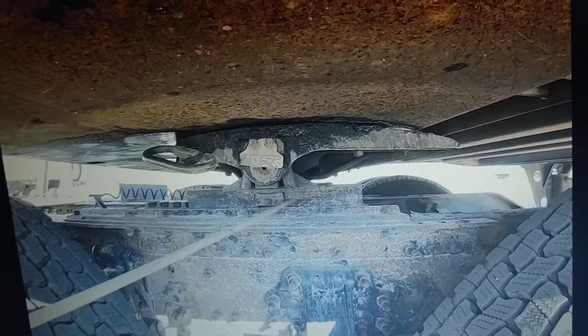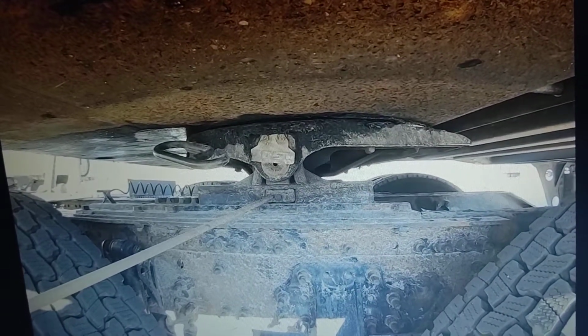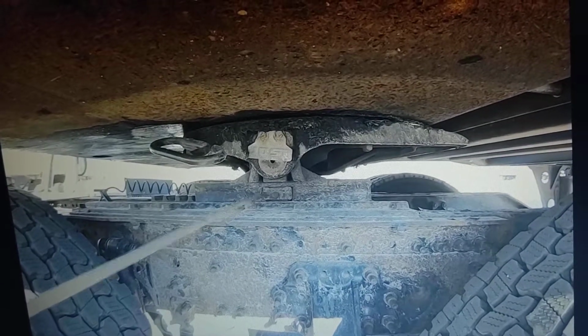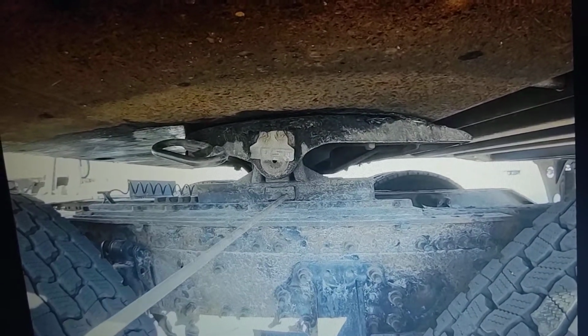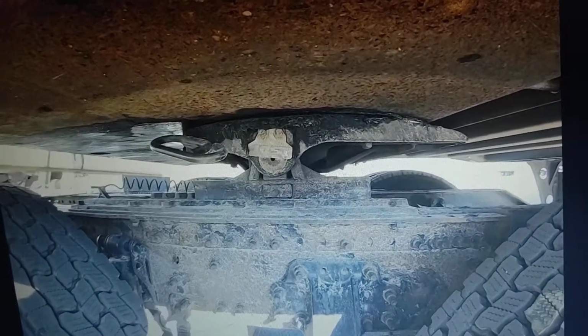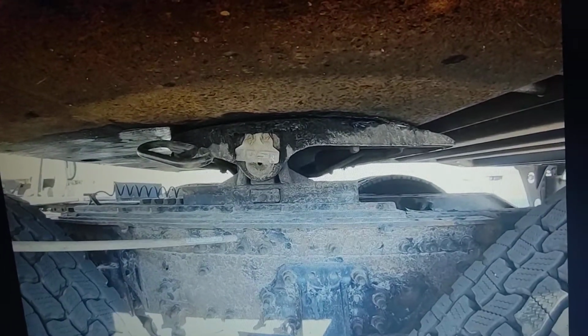We're going to check our fifth wheel slider locking pins. Okay, this fifth wheel right here can move back and forth. There's slider locking pins that lock it in place to ensure that it doesn't move. We're checking to make sure those slider locking pins are locked in place. This one here you can see. Some of them you cannot. They're on the inside and internal. All right, please just check to make sure those are locked, or mention that you're checking to make sure those are locked.